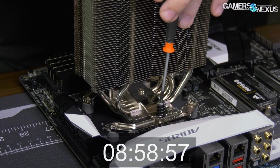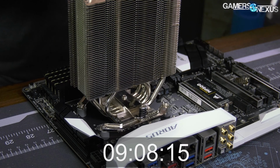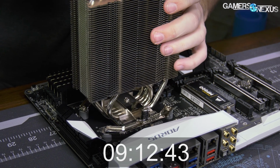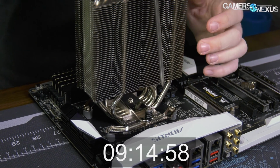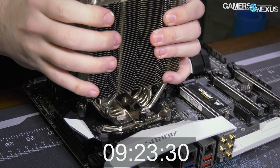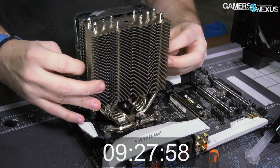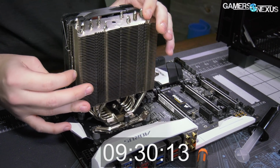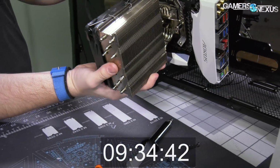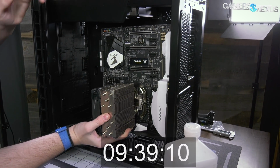This screwdriver is tiny. You know, a side benefit of screwing these in simultaneously is that we're going to have better distribution of thermal compound. It's going to spread basically perfectly evenly. Okay, that's way better than where we were with the liquid cooler. And I have a whole crate full of Noctua fans that we're working on testing, so we can even put some more in here to get some front intake, but we'll worry about that later. Kind of got enough to worry about as is.